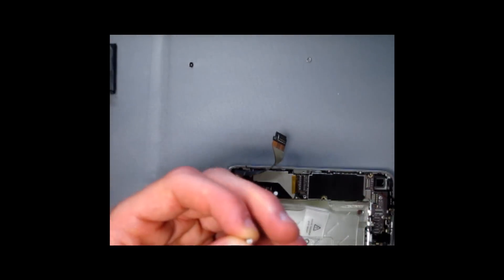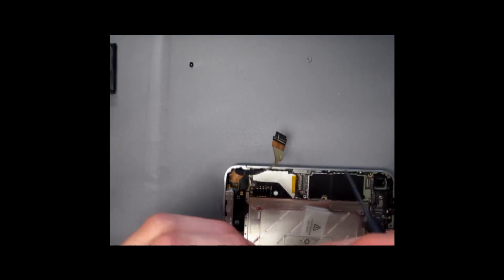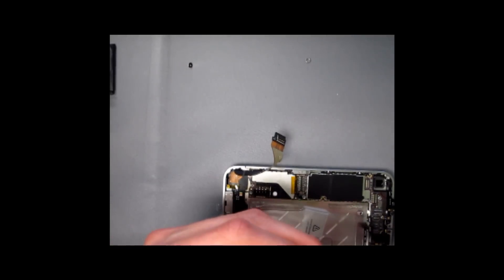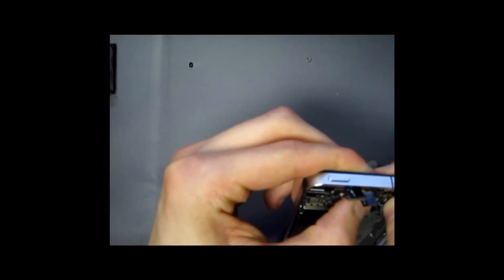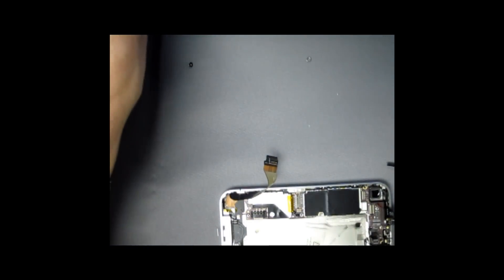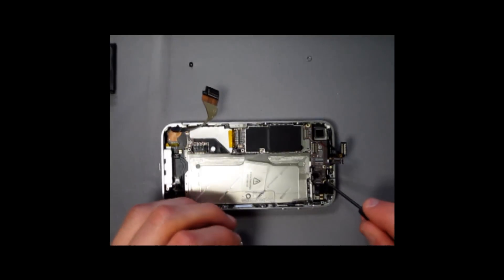Once it's in, go ahead and screw in the watermark screw, which is the one with the white head. Move the little paper just to make it easier. The motherboard just has to snap in right there. Next, take the screw which looks a little bigger than the others — it goes right over here.